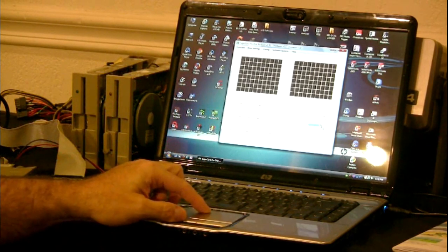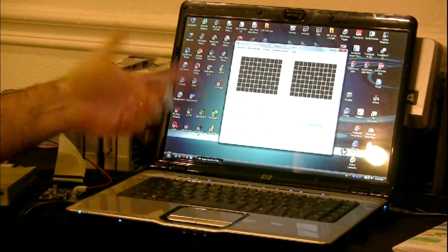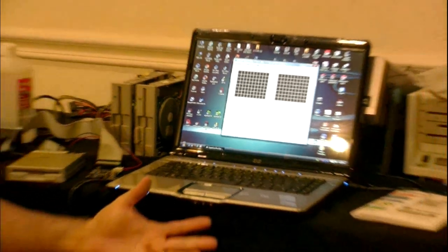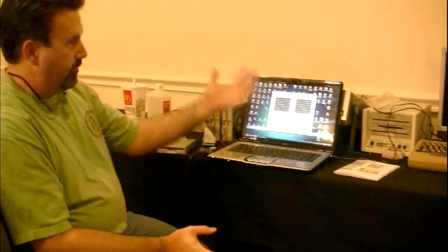If you select Commodore 64, you can select half tracks if you want to copy them; otherwise it just does every full track. You can make SuperCard Pro flux images of the disk and store them on your hard drive. The flux image can be for any of the formats, and then you can write the flux image back to recreate the disk anytime you want. You can also copy drive to drive — a single drive copy back to itself immediately, or if you've got two drives connected to the SuperCard Pro board, you can go drive to drive directly.